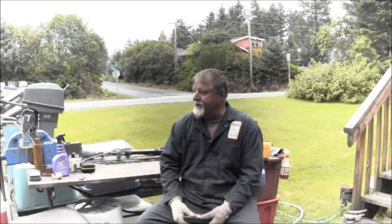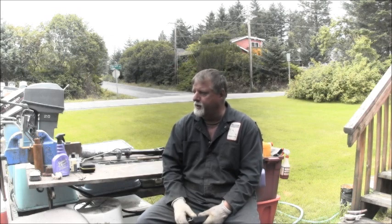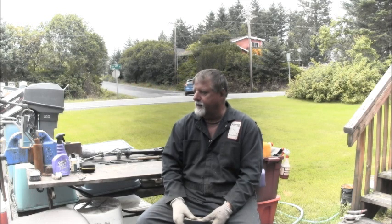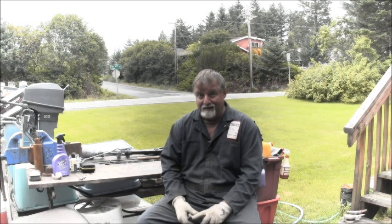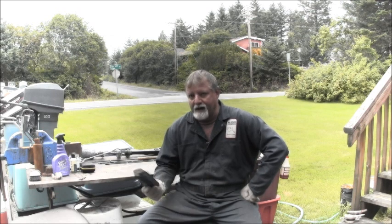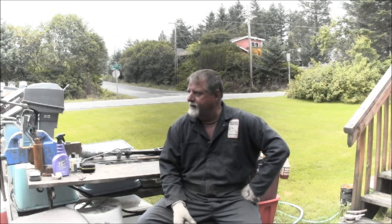And then something I do sometimes, I didn't do it on this motor, but I do it a lot on the white Johnson parts, is I'll put a coat or two of clear over that. And what it does is it seems to make cleanup a lot easier. When I put them in my tank and it's full of yucky, oily water, if I have a couple coats of that clear on there, then I use the Super Clean or whatnot to clean the oil off of it, and it just rinses right off. So it helps in that regard.